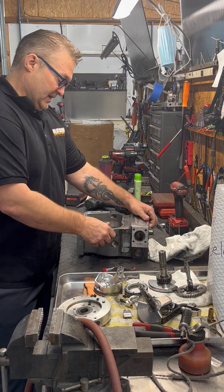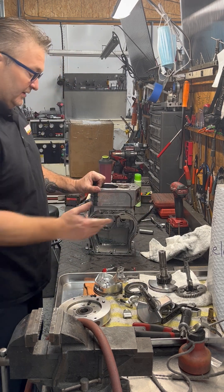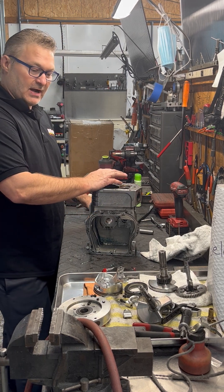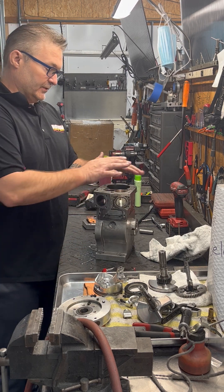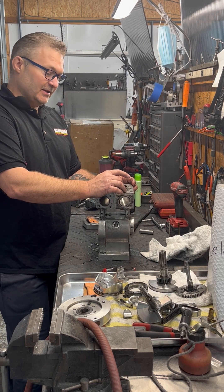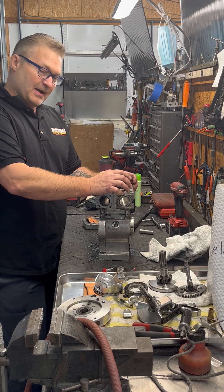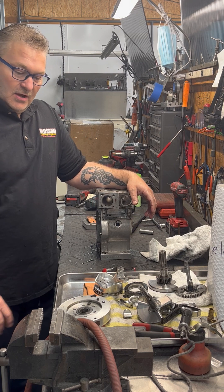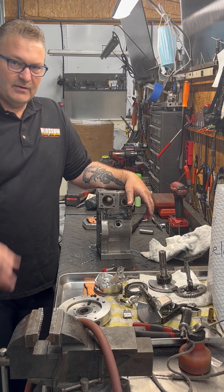So basically I'm completely disassembling this motor, which is what we do. Now I'm going to take this motor, put it in the parts washer, let it soak for a while, and clean all the parts up. The motor will then go over to another bench where it's going to be bored and honed, a valve job will be done, and then it'll come over to the assembly table where we'll assemble the whole motor. Hopefully this video helped you guys out on taking apart one of these things — we'll see you guys next time.